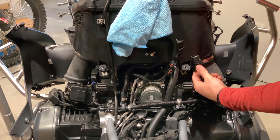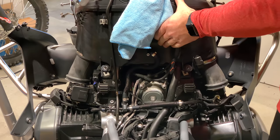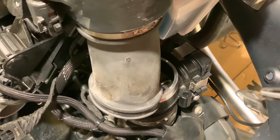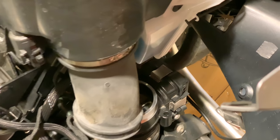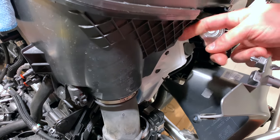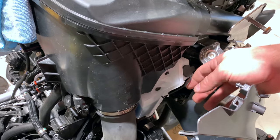There are some quick releases here. I forgot the coolant needs to be undone — look over here, you've got the coolant reservoir. You can pop it off pretty easily, but it will leak if it's not kept upright. Get a zip tie and zip it up to this bracket. The coolant reservoir has to come off because it's fixed to the air box. Just have your zip tie ready because it will leak if it goes sideways.